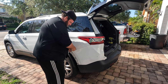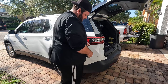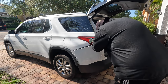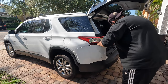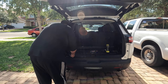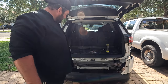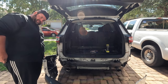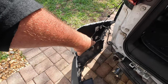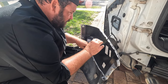Using the trim tool again on this side — you've got to be super careful you don't break this piece of trim either. That's a little bit better. Just got to pop them down. Now here's the tough part — go along the bumper back here. This one came off a little easier. And hey — got it off! There's a whole electrical hookup over here. There's a little quick disconnect right there we've got to pop off. This is for the proximity sensors — there's a red tab that locks it, push it back to unlock, then push the black tab behind it and push it apart. Be careful — don't break your pigtails.